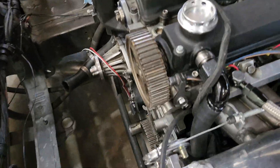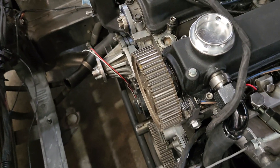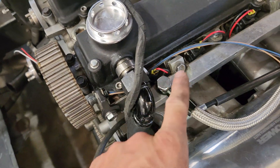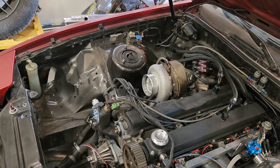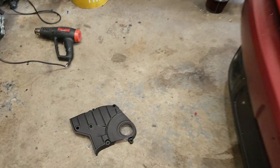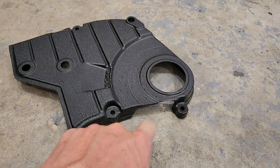The only concern is if the steel gear throws off the hall sensor, but I brought the magnet above flush on the back of the gear so hopefully it separates from the steel and reads fine. I know some people have run it like that and it has worked. The cam sensor bracket is just a small fabricated piece — the sensor drops in with a nut on both sides. I'll run the wires underneath and up through the firewall.